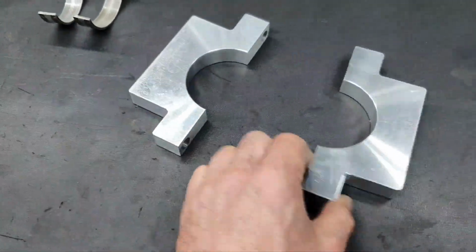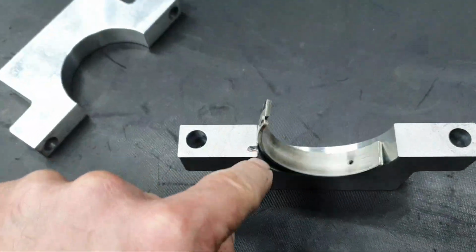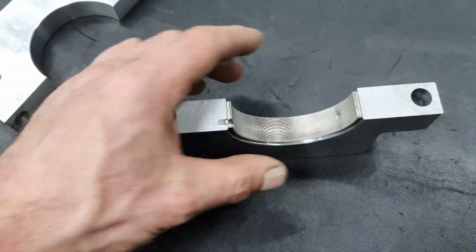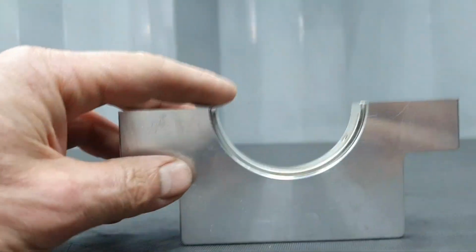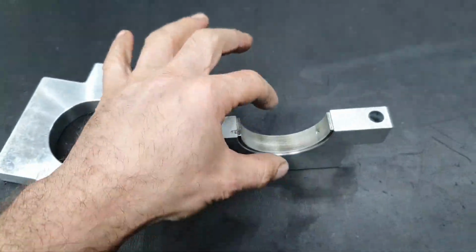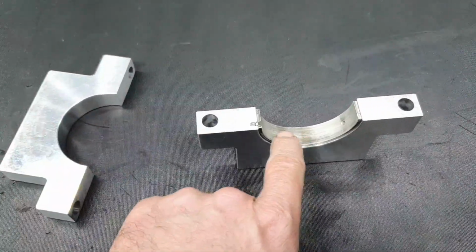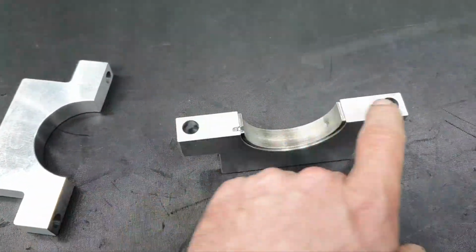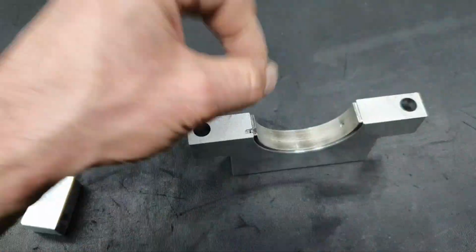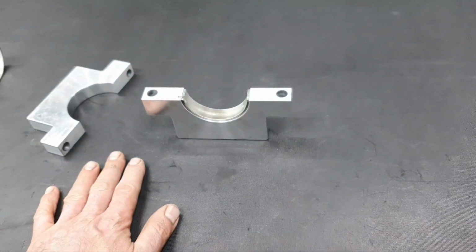Okay, and I was not expecting it to be like that. I just cut this piece here to put the bearing in. Take a look. This I just want to hold the crankshaft in place to be able to insert the three pistons. Alright? It looks beautiful. The bolts align excellent. I already saw that. Assembly grease here, putting it in place, holding the crankshaft in place, then installing the pistons properly. How nice.